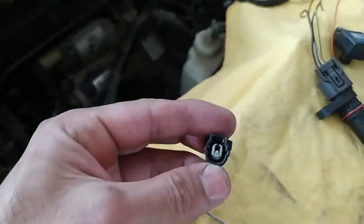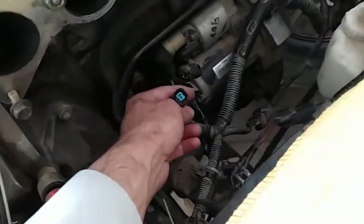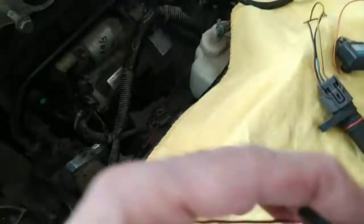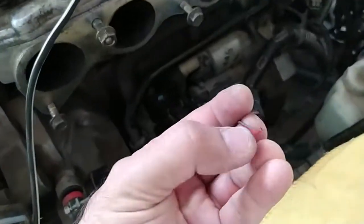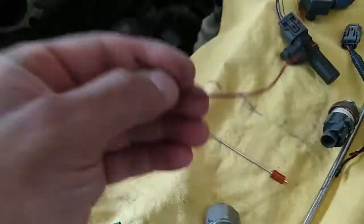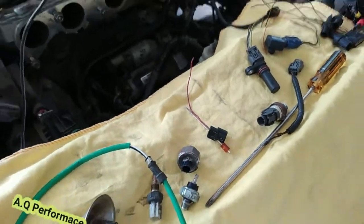The internal wire patterns are different between K20 and K24 knock sensors — this wire is broader and a different pattern — so you cannot swap the wire directly. You will have to cut the grip, peel off the rubber of this wire, and then attach the grip for the K24 sensor.